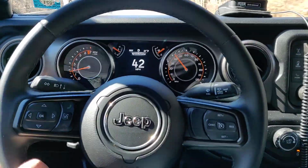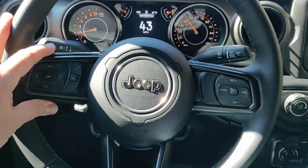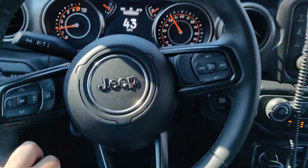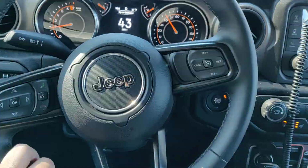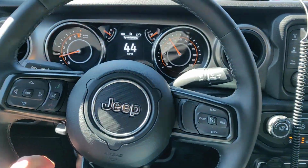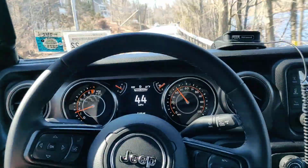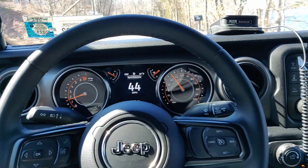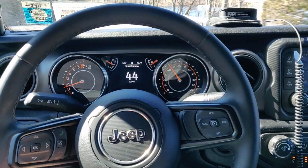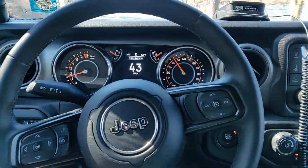So you're holding the wheel, let's say this position of the wheel's at 9. This is 3. Generally, as you can see on this angle, you can move it back and forth and it doesn't really move the car. But what I noticed the Fox dampener does, it'll actually hold the wheel now, and it allows the vehicle to track as opposed to wandering, and what I thought before was like oversteering.